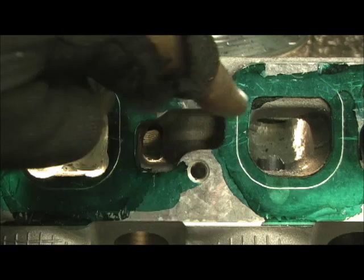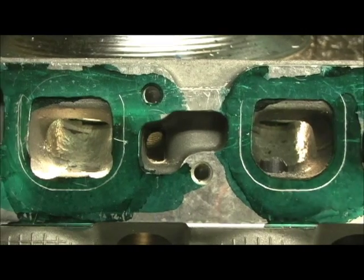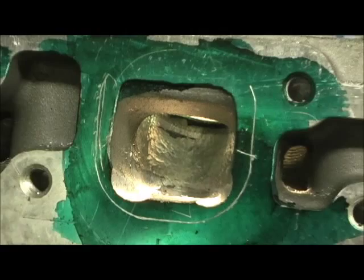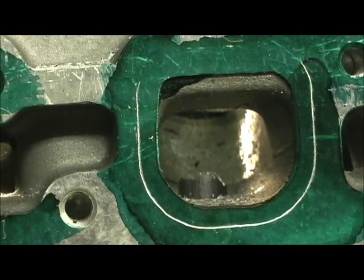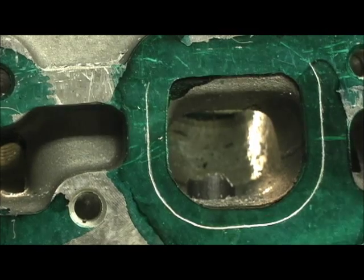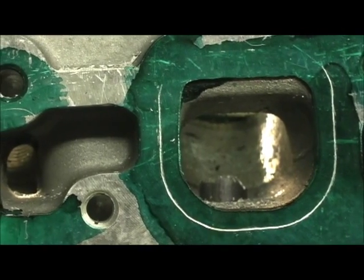You can just see — look at the big old chunk of guide sticking up. Look at the amount I cut. You tell me that ain't a difference. Now the cross-sectional area is probably a 10 to 15 percent increase on the exhaust. CC-wise, I would say 10 to 12.